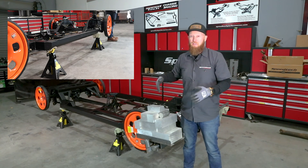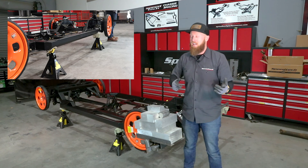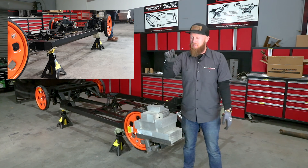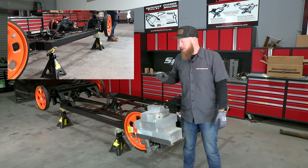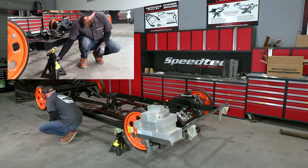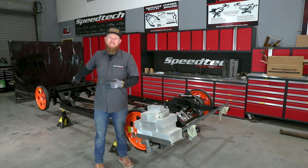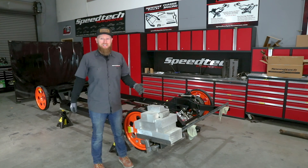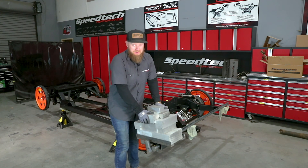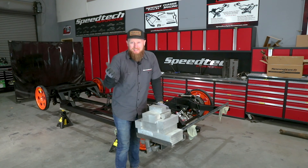We're set up here with the same 140-pound setup of billet that I used for the flex test on the stock A-body chassis. If you remember, I was able to walk over there to that frame stand and just pull it right out because there was so much flex — there was about a good three-quarters to an inch gap. Let's see what happens. No movement at all. Full weight of the chassis on that stand — the last one I was able to pull right out. There's no flex, and on the last test I pushed on this and there was a bunch of dancing happening in the back end. Here, nothing — solid as a rock. That's our extreme chassis.